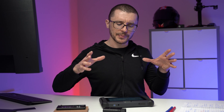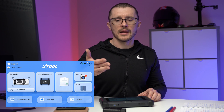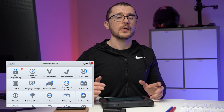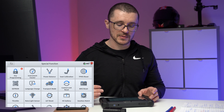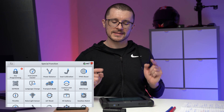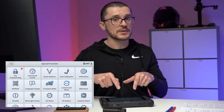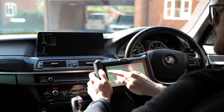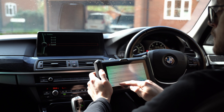Somewhere on the screen and in the description is where you'll find that video, but the list is quite extensive. Expect the normal things: service interval resets, electronic parking brake activation and deactivation, DPF regens, and a lot of normal day-to-day functions. The way you actually engage those functions will be a little bit questionable, because sometimes those functions will not work from the special menu and you will need to access the ECU you want to work on first, and only after that perform the expected procedures.